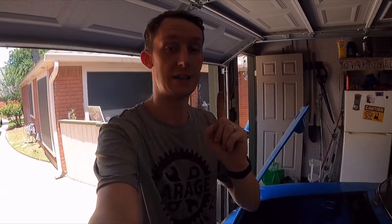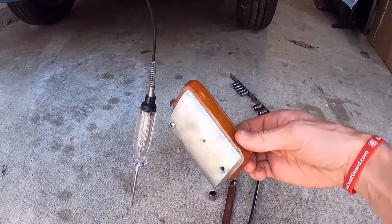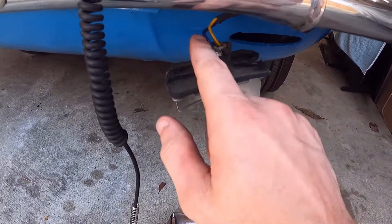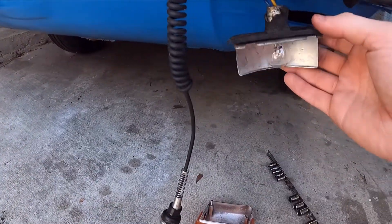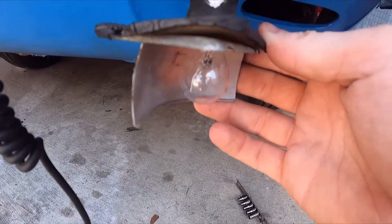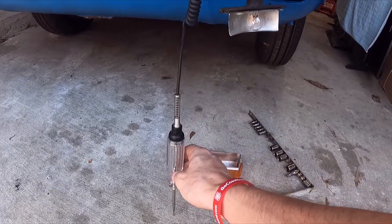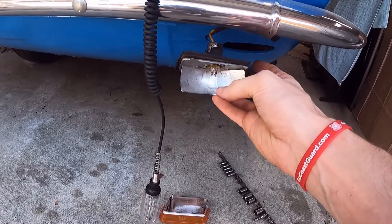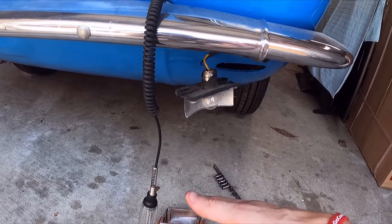So it is day two now. Yesterday I had to take care of some family stuff. We're going to continue working on our blinker system. What I've done is gone and double-checked my bulbs — I pulled off this one blinker housing to expose it here. Our connections are good on the top, nothing loose, so that's a good sign. But we know this blue wire, according to our diagram, is part of our indicators. I've double-checked that this is a double filament style — you can see there's two filaments in there, meaning each one is independent. So I've hooked up our test light to a ground on the body, and I'm going to test to see if we have power coming to our blue wire here.